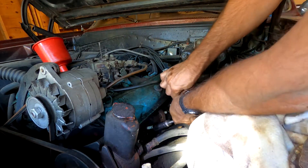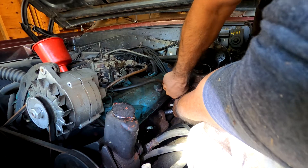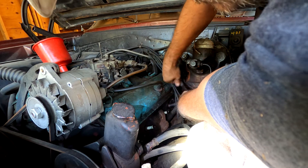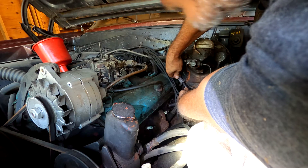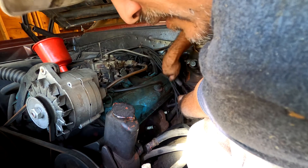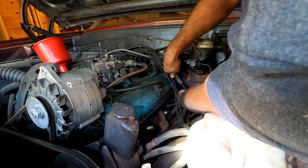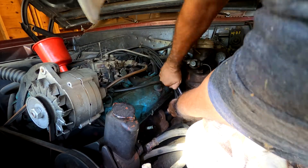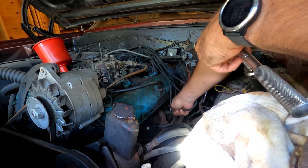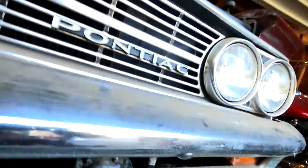Go up and get some three-eights, then I gotta go get home, take my truck. We're just gonna tie into the bottom of the fuel pump — I already undid it. We're just gonna put our own hose in the bottom of the fuel pump. You want four or five feet so you can put a gas can out there somewhere. We're gonna hook up a temporary fuel line here and see what we got.